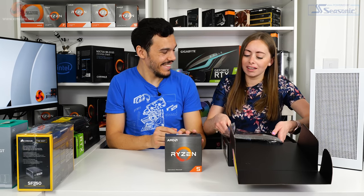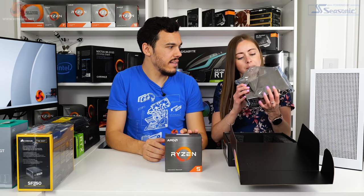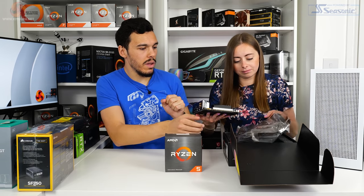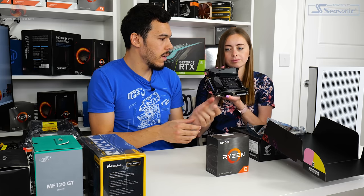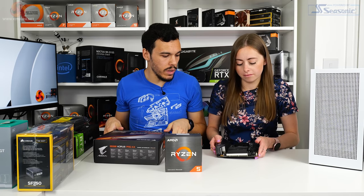And here's the processor we've chosen — one of my favourites: the AMD Ryzen 5 5600X. We regard this as probably the best AMD processor currently for price versus performance, just for overall balance. Really, really good chip. This goes with the B550 motherboard on AM4. You should be careful with static — this is an anti-static bag. You can get an anti-static bracelet, or you can touch a plugged-in piece of metal to ground yourself. Keep the box, because there's a bunch of accessories in there that we'll come back to.